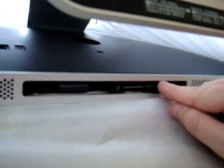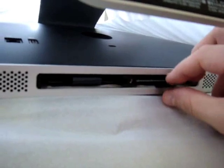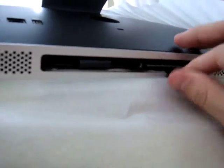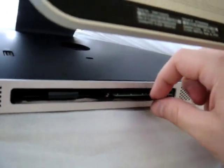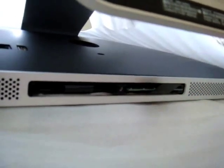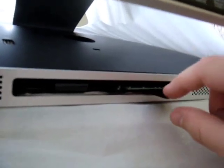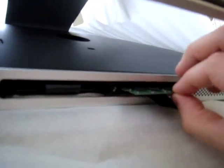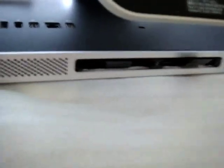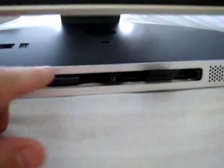Now what you're going to want to do — there's a little ribbon there. It's harmless. Just pull it right out with your finger. Pull it and it'll pull the RAM out. You need a little bit of pressure — about three or four pounds of equal pressure. I used two hands. You're not going to do any harm to your iMac. The ribbon pops the RAM out of place, then you manually pull the RAM the rest of the way out. Go ahead and put that RAM to the side for future use or for a friend's computer.